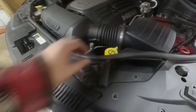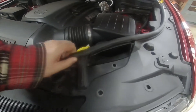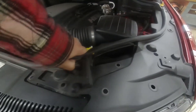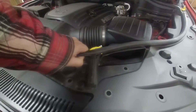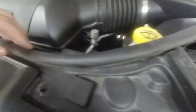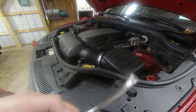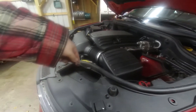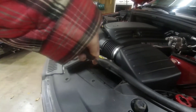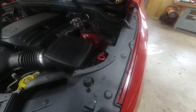For the more complex driver's side, we now have to remove the gasket here. It's just push-riveted in. You're just going to take your hand and pull it straight up — it should release the water gasket here. There we go. They do make a tool to do this — it's like a forked screwdriver. You're going to put that in where the little pop plastic rivets are and then just pry it up. I went ahead and removed the whole gasket, though you don't have to.